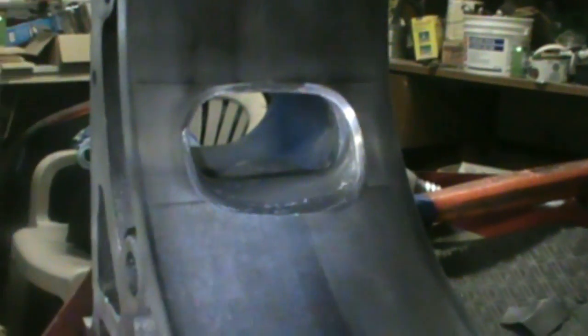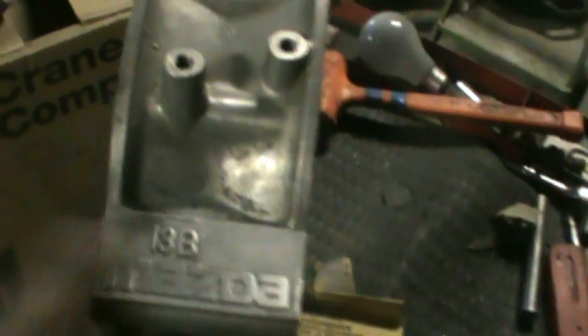I've got to do some more sanding on it, but if I can do all that tonight... So I went over it real quick with this little sanding bit, and now I'm just gonna go with these little flap sanding bits — it'll take it down a little bit smoother and it's pretty much good to go. Now I got that smoothed down pretty good. Once I paint it and let the paint dry nice and good, I'll just go back and sand that off again now that it's all level — it'll make it a lot quicker, just a quick zip across and nice shiny letters. So I got my irons here, they're all clean, street ported, and ready to go. I'm just gonna set them all up with the dowels and get them ready to get painted. If any paint seeps through a little bit you can just clean it up with a scotch-brite pad.